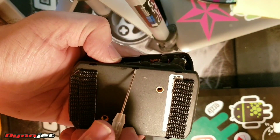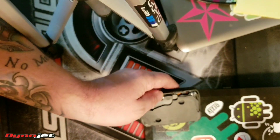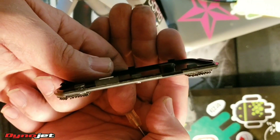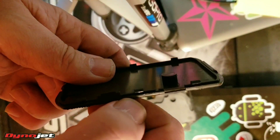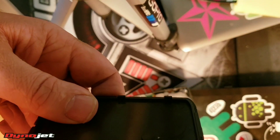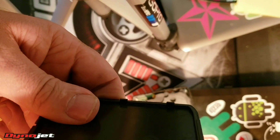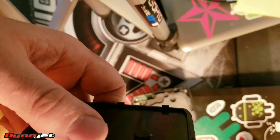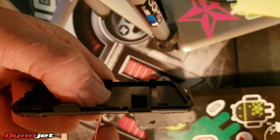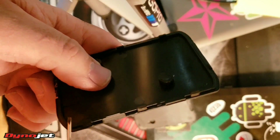See where this hole is? There's a tab inside this back plate. If you stick your screwdriver through that hole, that tab moves inward towards the center of the device — all of them do. So you put it in there and push, get something in between here and pry. Walk it all the way around, lift it up a little bit at a time.